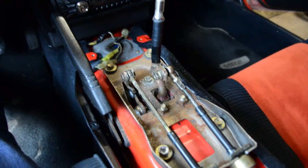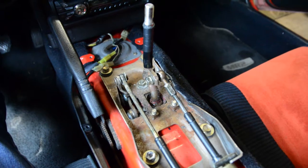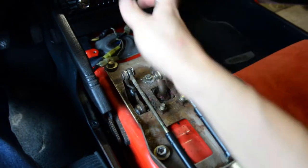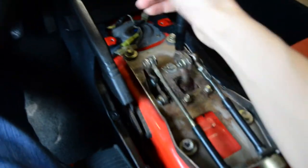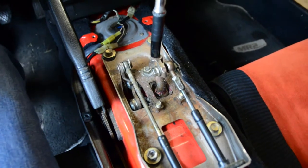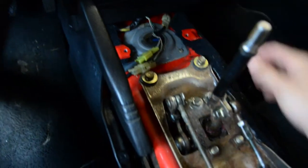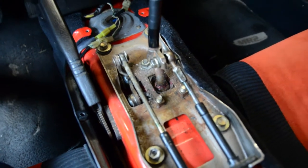Here we are inside the car - I'm doing this freehand so it may be a little shaky. I just wanted to show you what the shifter base assembly looks like. You can see the shift lever sticking out here and I want to give you an idea of how the cables operate. The cables are right here - you push this one to the left, this guy moves back and forth. And then this one moves forward and back - first, second, third, fourth, fifth, reverse. It is gunked up beyond all reason, so it'll definitely stand for a cleaning. These are where the shifter base bushings will go - there's two in the back and two in the front - and the shift cup will go inside there.